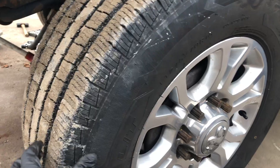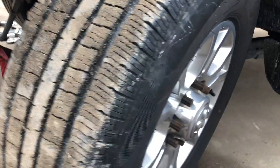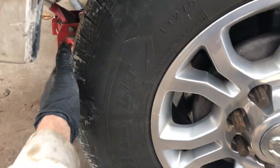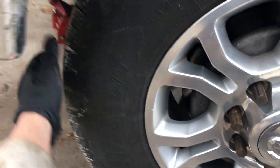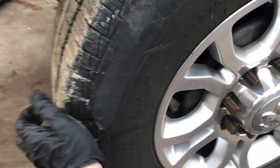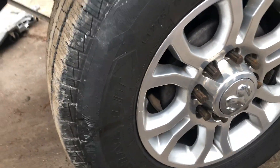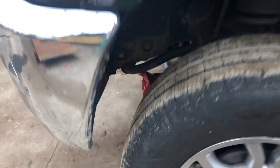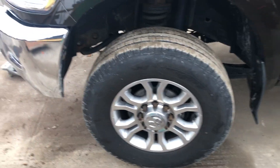They almost swing on their own — there's not much resistance here. They do swing on their own if I give them a little shove and they keep moving. So I'm guessing it's not in the ball joints. Moving on, we'll check the preload on that steering box back there.